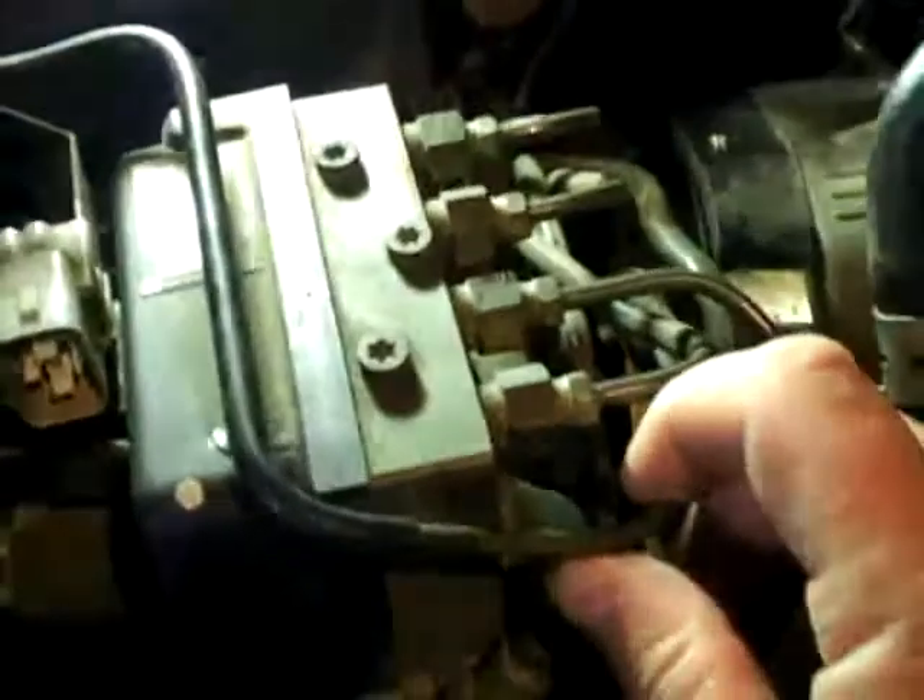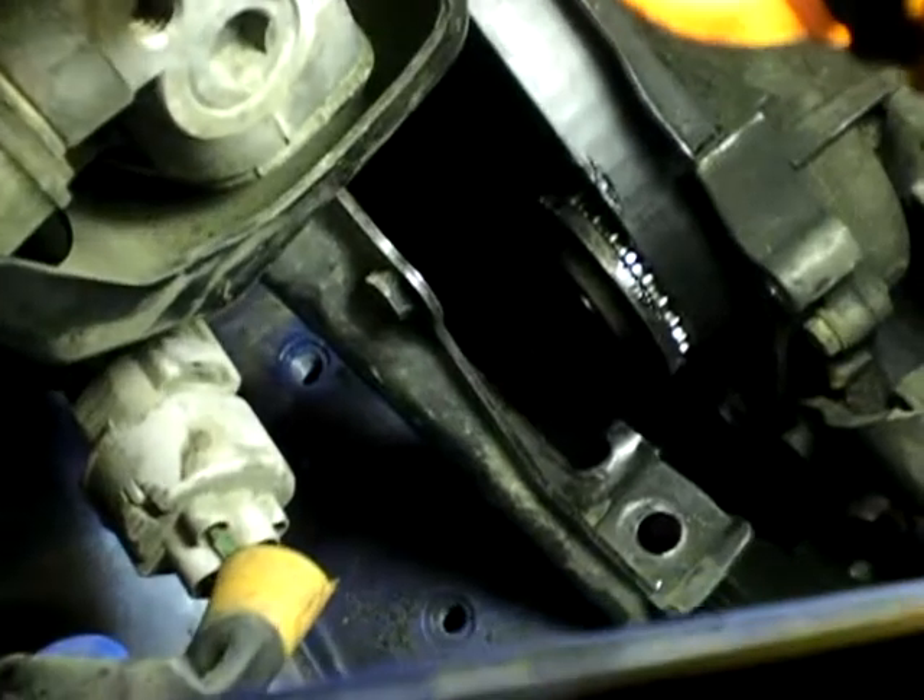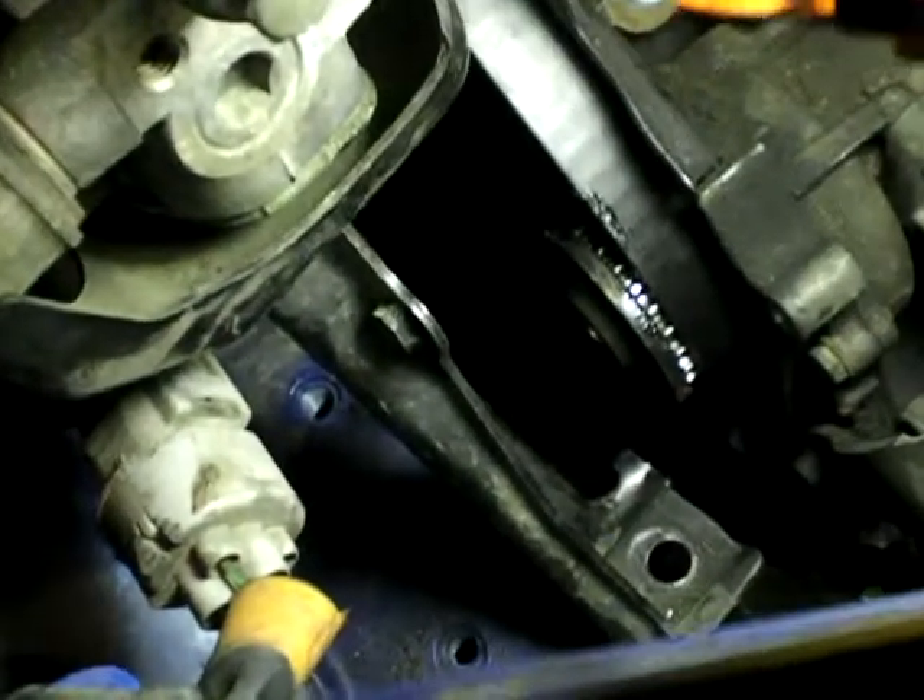Right, this is at the top end of the engine. I've had to remove a whole heap of stuff out of here — the alternator is gone, and I've had to loosen and take all the brackets out for all the ABS assembly. Everything is probably hard to see here, almost impossible to see anything actually, but you can see all the oil all over the belt. It's just shocking.